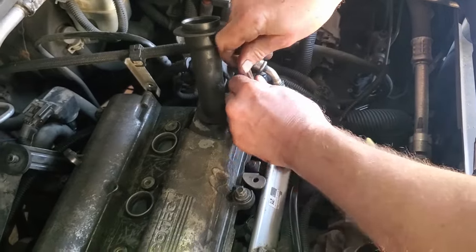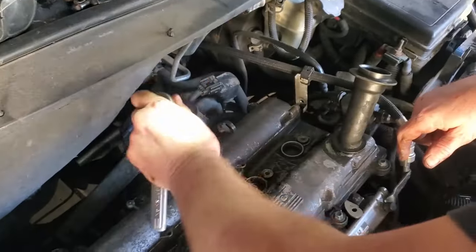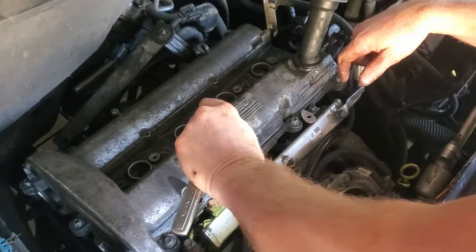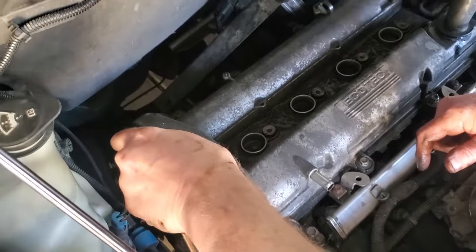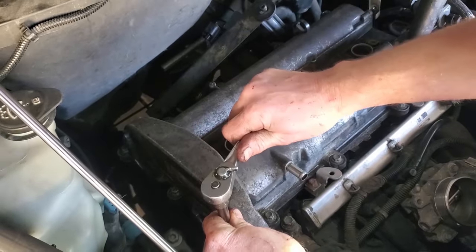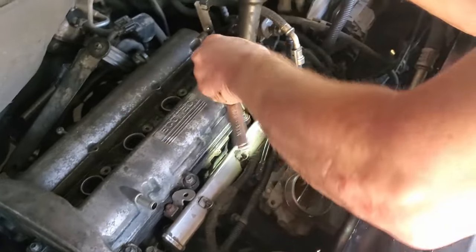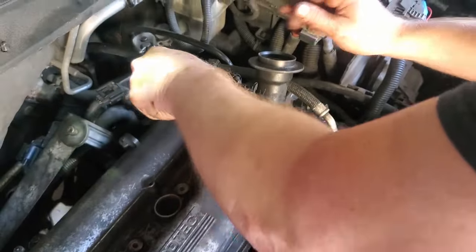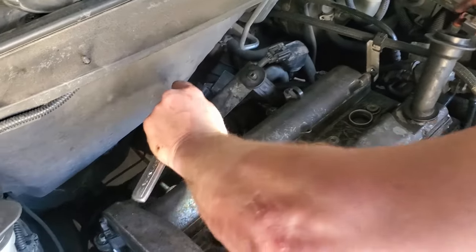All right guys, we're finishing up tightening the 10 to 11 bolts on the outside. I just go back and forth between each one, from one side to the other — you don't want to tighten one too much right off the bat and then have something not be seated properly. Like I said, I don't have a torque wrench, so I'm not going to over-tighten or under-tighten. This is my last go-around checking things. If you really want to do this the professional way, grab yourself a torque wrench, look up the specs, and you'll know when you don't want to go too far. Then we're going to go ahead and do the ones on the inside with the spark plug — I'll show you guys how to do that real quick.